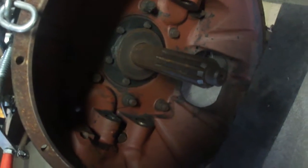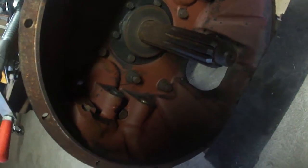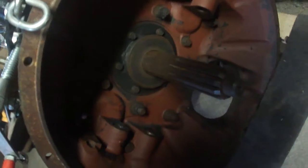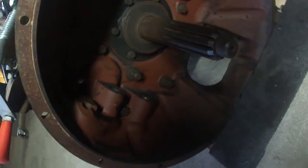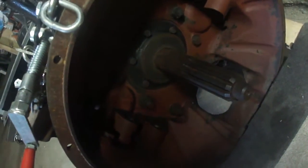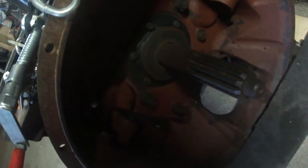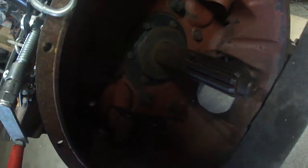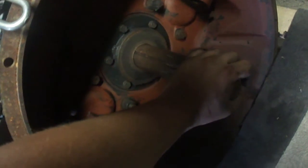If you don't know about double clutching, you can always read up on it. With any Eaton Fuller, you double clutch — that's per Eaton Fuller's recommendation. You can float gears or single clutch, but pretty much any Eaton Fuller you're going to be double clutching. The clutch brake stops the rotation of the input shaft when you go ahead and try to put it into low gear.